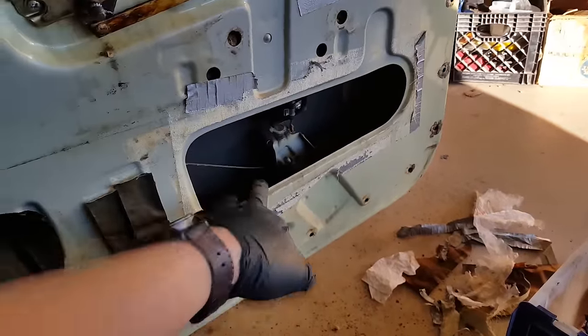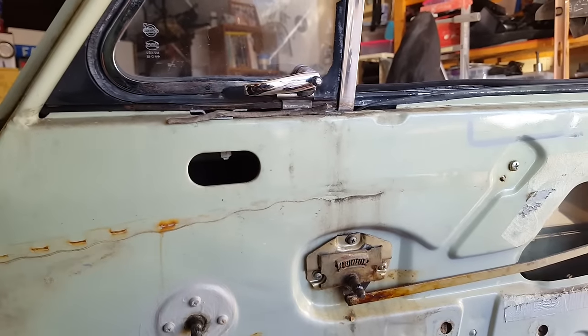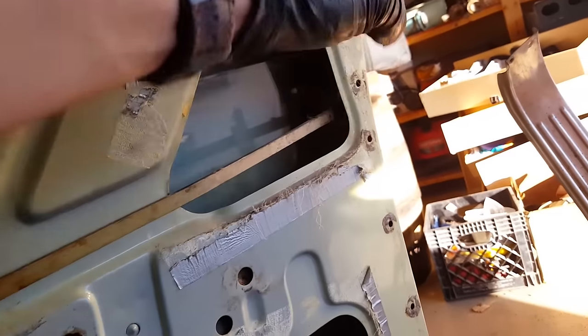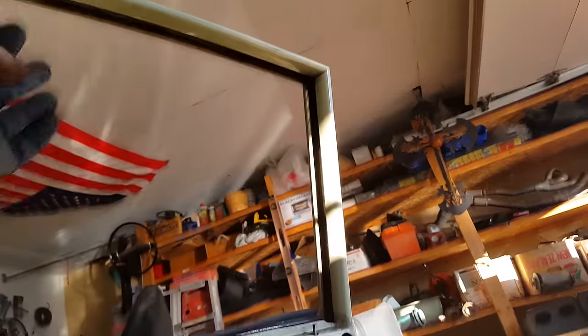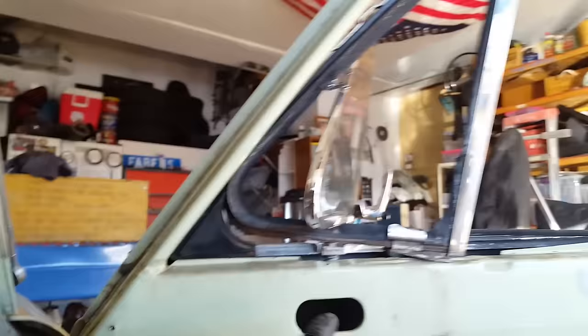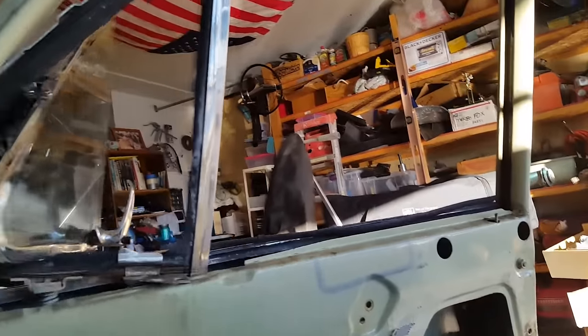Cable adjustments there for the window, which is on a chain. After you've pulled out the left rail — disconnect it with the screw down in here — then disconnect the right rail, which is two outside screws offset. Pull that out, then pull out the top ones. Tuck the window behind the little metal piece; there should be a rubber bump stop in that hole. Drop the window down. That gives you space to move the corner window out after removing the screws along the edge. The rubber triangle comes out first, giving wiggle room to pull the rest of the window out, and then the glass comes up and out.